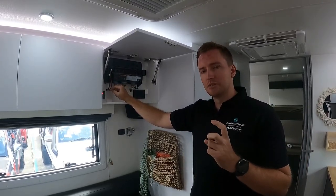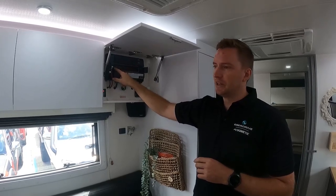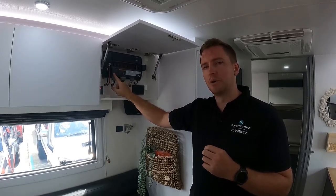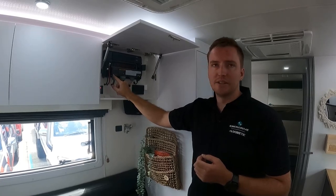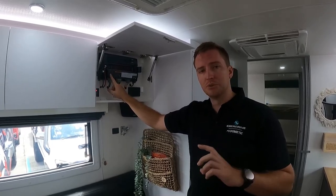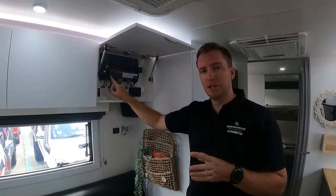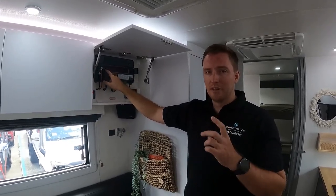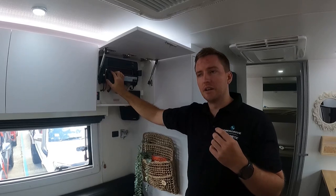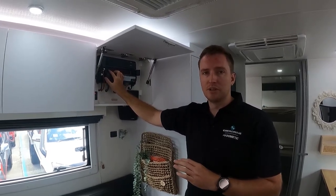The other advantage is that we set those limits — so if we put a 10 amp fuse into a circuit, say circuit one which is our fridge, I set that to a 10 amp limit. The soft fuse sitting behind the unit — which is what's switching that circuit on and off — I set to around a seven and a half amp limit. The advantage is that if a circuit is going out of spec or drawing more current than it should, the MOSFET will blow and display on the screen telling us there's a circuit that is over current. You can acknowledge it and it will reignite that circuit and get you going again.